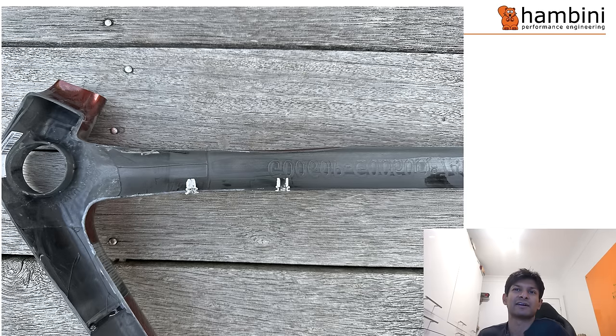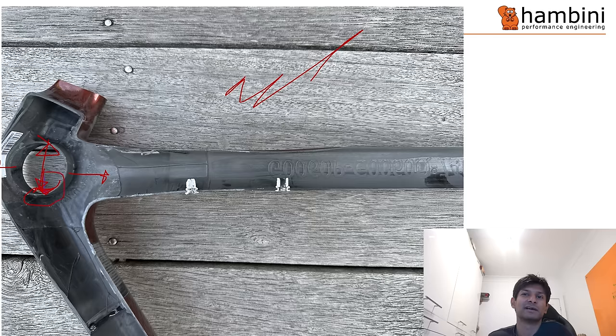If you look here you can see the wall thickness around the bottom bracket is not uniform, and that is considered in the bearing world to be fairly poor engineering practice. On Giant bikes quite a few bottom brackets are oval and undersized in one direction and oversized in the other. It's almost like a razor blade - just decaying from very thick to nothing - giving you inconsistent compression around the bearing.